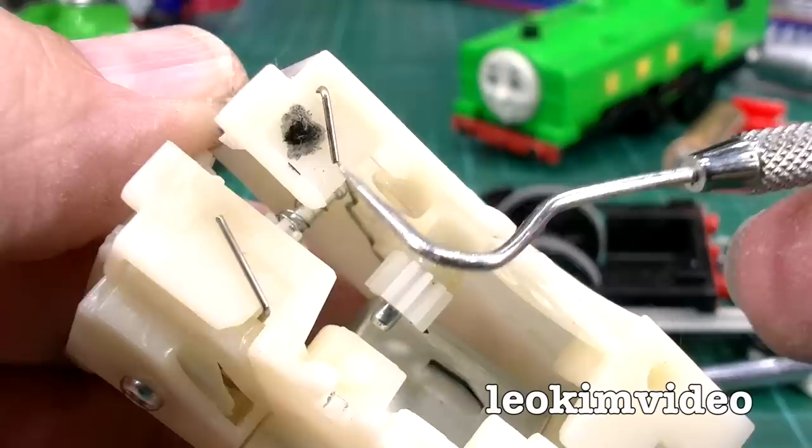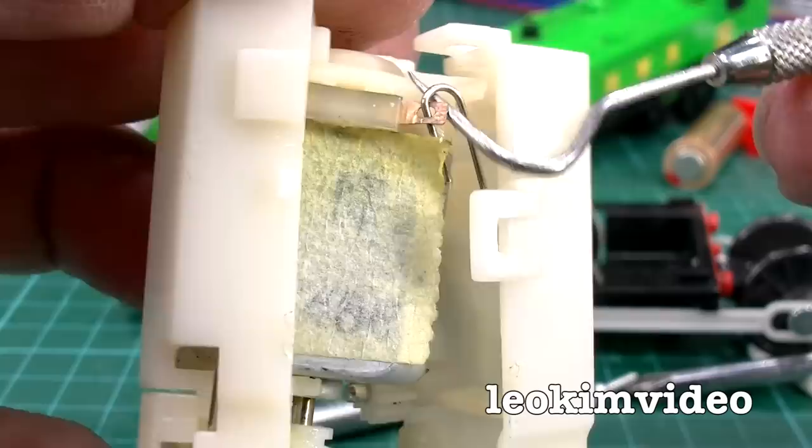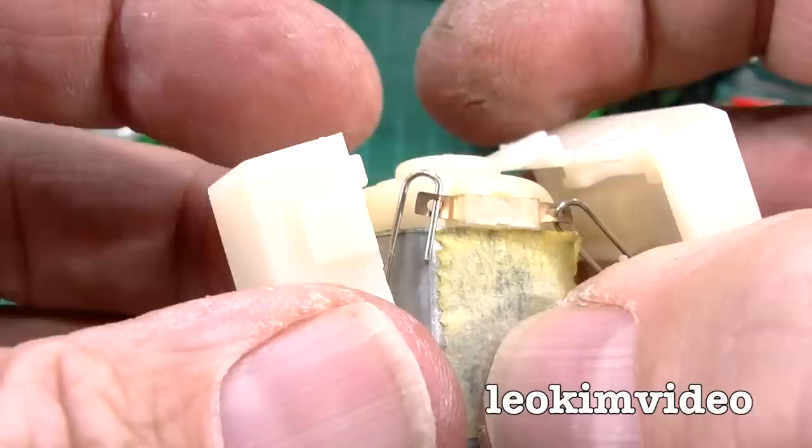Here's my suspicion. This is the one that — as I thought — goes up here. It is actually connected to one side of the motor. And when you look at the way they've connected these together — well, basically there is no connection. It's just sort of 'let's hope this makes connection' because it's all just done like that. There's no solder, there's nothing. I think this is the problem area, but we're yet to test the motor, and of course there is the same on the other side here.